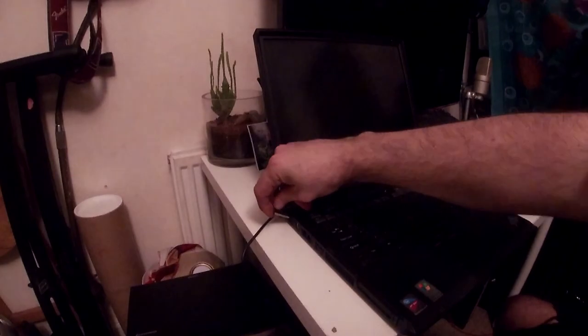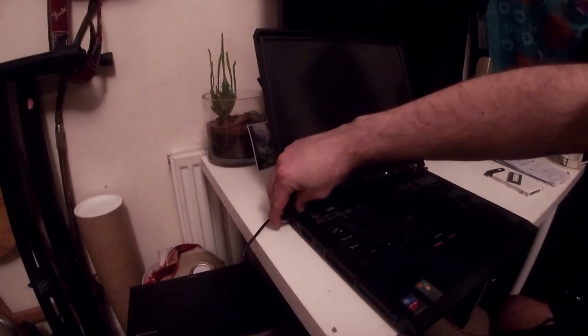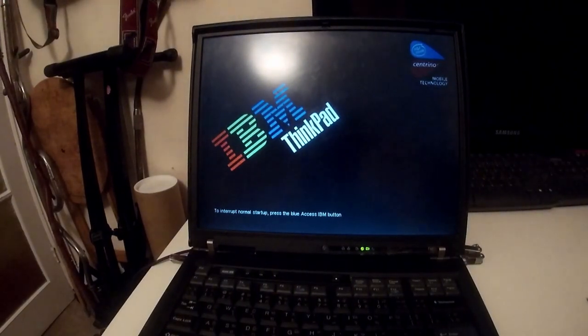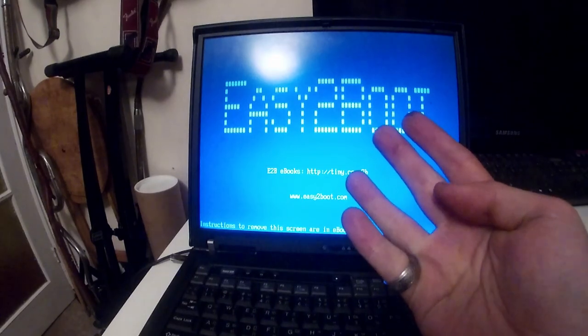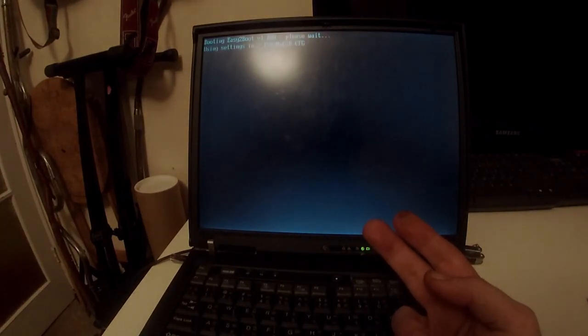In fact, actually, should I just move the camera? So put the USB stick in that we've prepared following Phil's Computer Labs video that I linked in the description. And we're basically following exactly what he did, but we're going to make a very small partition for Windows 98. I'm just gonna split it evenly, 10 gig, 10 gig, 10 gig, 10 gig for each thing. So first 10 gig is for Windows 98, 10 gig for Windows XP, which may not be enough, so I may have to expand that. I'm not really sure. Maybe I might make it 15-15, but we'll see how it goes.